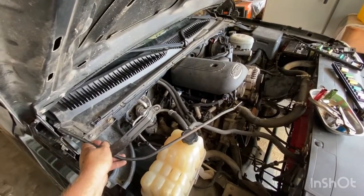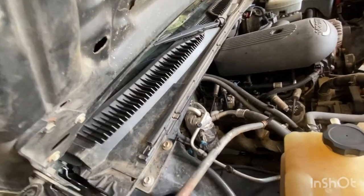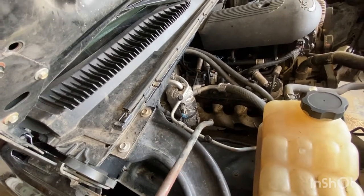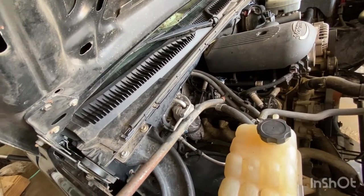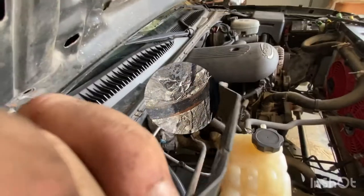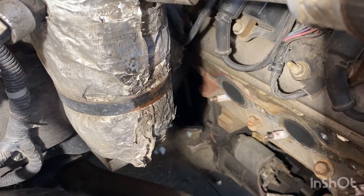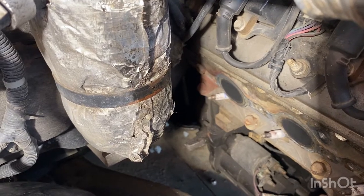I was able to get the tube out. A little word of advice - I did have to put two of the bolts back into the manifold just to be able to reach and grab it. I would recommend removing the dipstick before you take the bolts out of the manifold, because once it's just hanging there it's really just in the way. I just unbolted it from the head, started twisting a little bit, and then yanked it out. The header just literally pulls up towards the front of the radiator and comes through your heater core lines and AC lines - it pulls out pretty nicely.